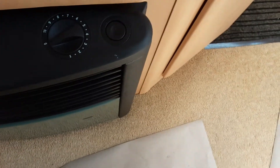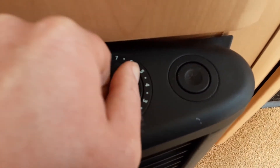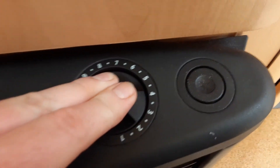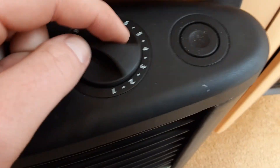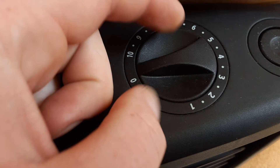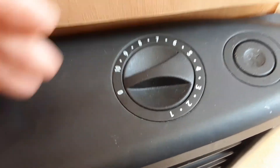On the right-hand side you've got the option to run gas heating. Spin the dial to between 1 and 9, press the dial in, and hit the igniter — similar to a barbecue or hob. Once ignited and you've got a pilot light in the window below, hold down the gas valve for five to ten seconds, then slowly release it. Once ignited, you can control the temperature on the dial between 1 and 9. To turn the gas off when you've finished, turn the dial all the way back past zero and that will shut the gas off to the heater.